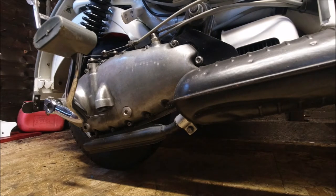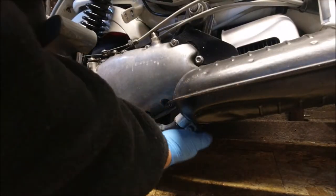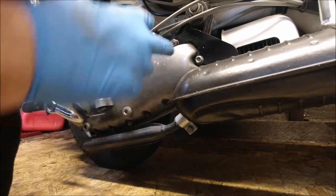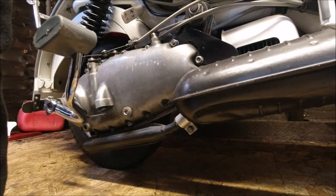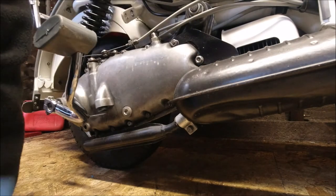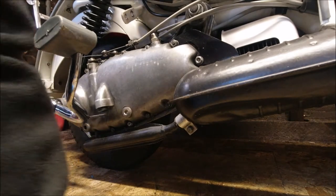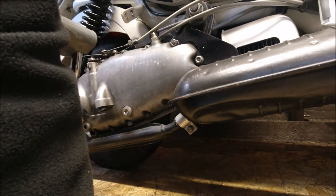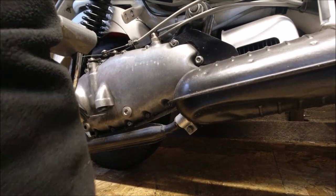exhaust time. So on a Series 2, you've got 1 bolt under there. There's none in the chassis, in the engine, sorry. 2 there, you've got a joint and 1 at the end. So we're going to need a combination of 13 mil, 11 as far as I know, and 10. So if I grab them, the 10 will do the little one first.